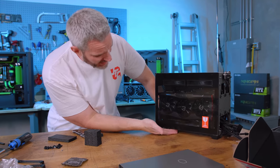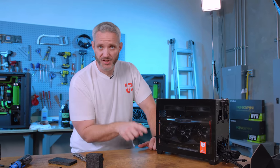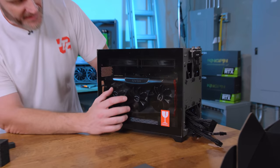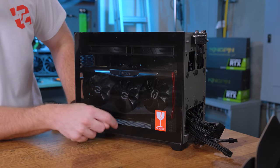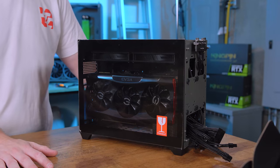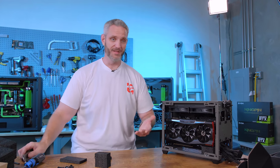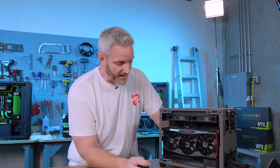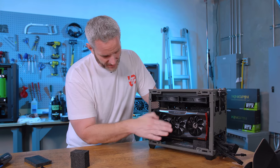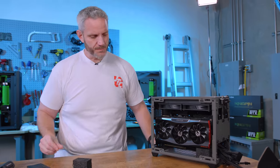This would actually probably be okay just because of how much intake there is on the bottom. But what you can end up getting is a lot of recirculation of hot air. Yes, we have two 280mm fans on the top — that's going to do a good job of pulling the heat out. But remember the axial fans exhaust both sides of the card, so you're going to have hot air coming down. Having the mesh panel on the side with a thick GPU means it's going to get as much fresh air pulled in as it can. You probably would see some throttling with this depending on what kind of card — this is a 3090, so this is clearly going to be the highest TDP card in this particular GPU family.